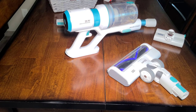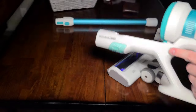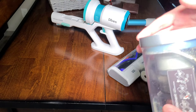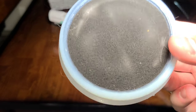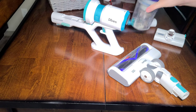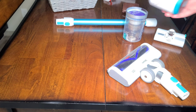Next, we're just going to go over some of the final features of the vacuum. This vacuum has one filter. To remove the bin and access the filter, you press this forward — the whole motor rotates upwards — and then turn the bin clockwise. To empty, you press this button right here and the door will open. The cyclone can also be removed by pulling these tabs. The filter is in pretty good condition — it's a multi-layered filter, foam with a high-efficiency filter on top. Pretty clean after all that dirt. The battery is removable and can be charged separately. You press this trigger button and the battery comes out. You charge it through this port. It is a 56, basically 57-watt-hour battery, which is pretty big for a vacuum of this price.